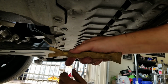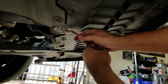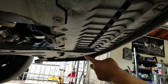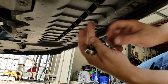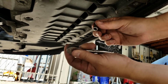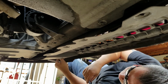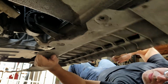I have these special plastic tools. They're very cheap, like $5, and just pull it out, and then now you can remove the actual insert. Now we have to do the other ones the same way. Okay, so to remove these screws here, we have to use a Torx T10 and a 1/4 inch ratchet. Alright, last screw to remove, and we should be able to remove this cover. There we go.